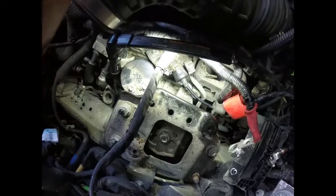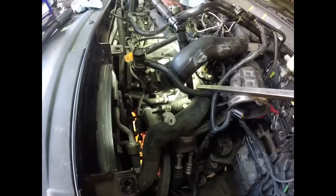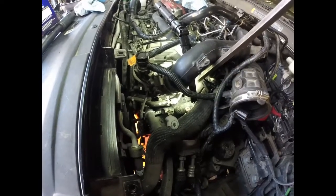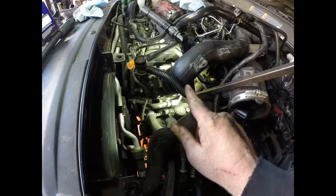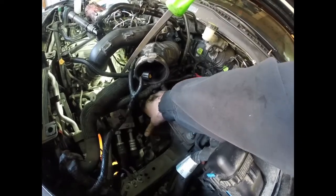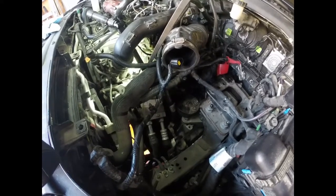I don't think I can show you exactly where the bolt is on camera, but I can kind of show you where it is. If you go straight down back where the transmission and the engine meet — which you can't even see from here — there are two somewhat big hoses that come off the back of the engine. If you kind of pry those over to the side a little bit — don't go too crazy because one of them has a plastic fitting — the bolt is right there. Follow this tube and go straight down and over towards the engine, that's where you'll see it. You have to get your ratchet through here underneath all these hoses where your shifter cable is at, and that is the main reason I am making this video — it's almost impossible to see where that bolt is if you've never done one of these.